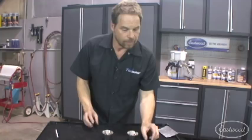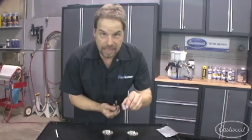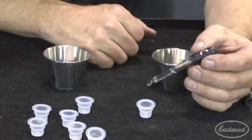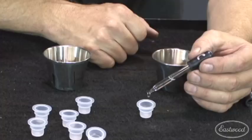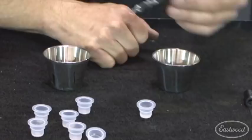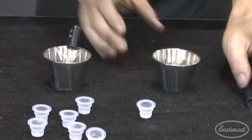This has a two-to-one mix ratio on the can. You can also expand it to four-to-one, which works a little bit better for spraying, but two-to-one is the recommended ratio. The 'C' on the eyedropper stands for clear coat. We're going to go two parts to one part, so with the eyedropper we want enough to fix a couple of chips. We're going to count out eight drops of clear coat. With a two-to-one mix you basically cut it in half to get the correct ratio, so eight drops of clear means four drops of catalyst — that keeps our two-to-one ratio scientifically exact and accurate.